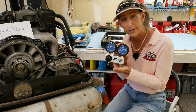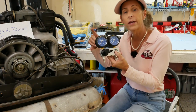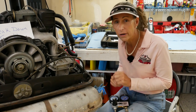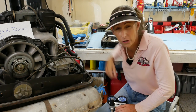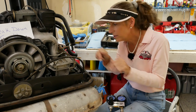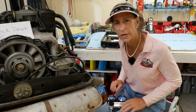What I like better is a leak down test. You get the cylinder to top dead center and actually put pressure into the cylinder via your air compressor through this little gauge here. It reads the input pressure and the escaping pressure, and the difference gives you some indication of how efficiently that cylinder is holding air. More importantly, it tells you where the air is escaping. If you hear noise from your intake plenum, your intake valve isn't seating well. Hissing from the exhaust indicates an exhaust valve issue, and noise from the crankcase breather means it's escaping through the compression rings. On a liquid-cooled engine, bubbles in the coolant indicate a bad head gasket.